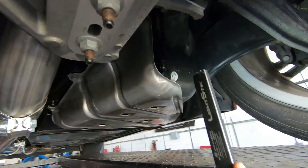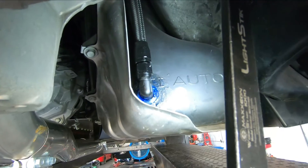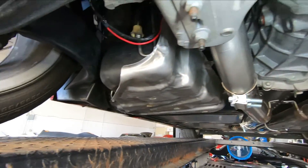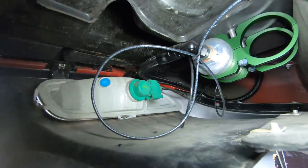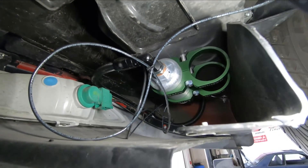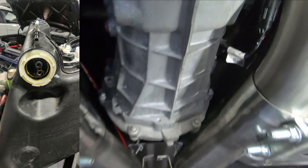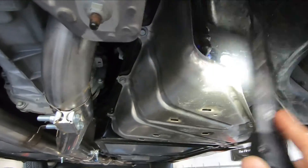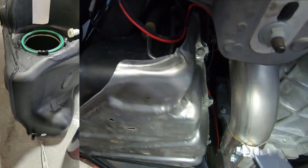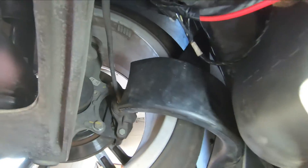This is my passenger side tank — this is the siphon tank. What I've done is I actually did a bulkhead fitting that is sealed with fuel resistant RTV. I have a bulkhead; I don't really need it but I put it there for extra security. We've got a 6AN feed that goes all the way down and into the inline Bosch 44 that's remotely controlled inside the cabin. I left room for another pump there. I got rid of the whole cross pipe and that whole siphon deal — this car is not going to be daily driven, so I don't really care. I just turn a switch on and it pumps all the fuel from here to there, so the gauges actually work still. On this side I have two fittings on top: one for the return from the fuel rail, and the other from this side. Everything is hardwired using Hella relays, and I added a switch — I'll explain why in a bit. We have the 6AN feed using the stock line going to the rail.